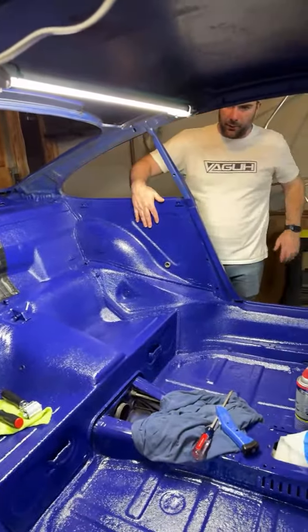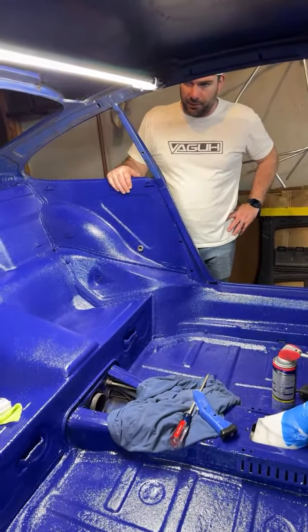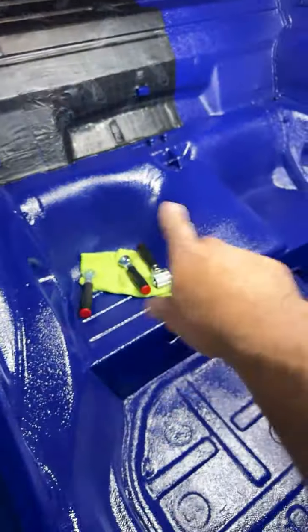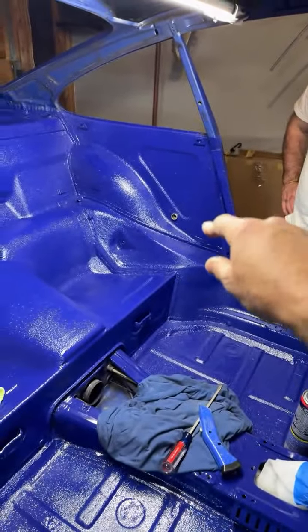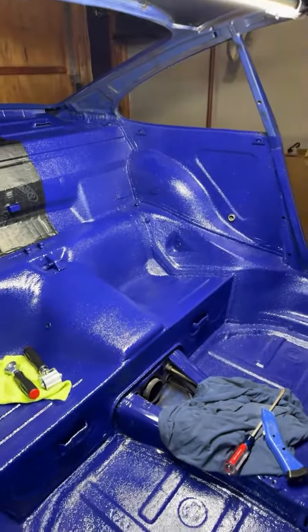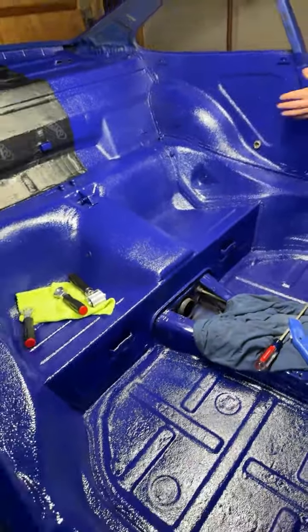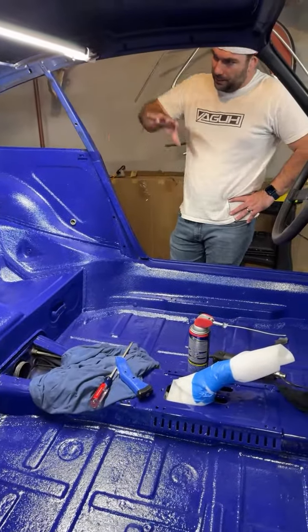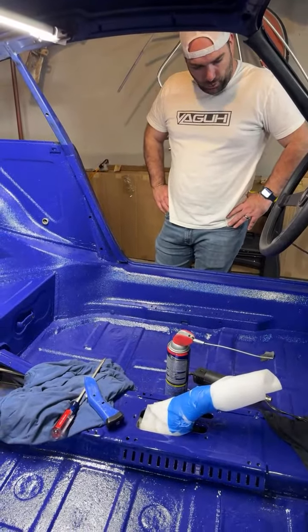We do still have those pieces that came off in fairly good order, but if we have enough, we'll probably put this stuff on here too. This butyl material fits into each of the seats independently, and then there's this rubber burlappy material that goes on the sides, but we're going to just do Dynamat on this back area, probably all the way down to the floors, to keep it insulated from the engine noise and outdoor noise, and nice and quiet.